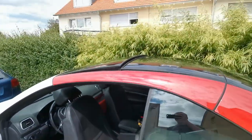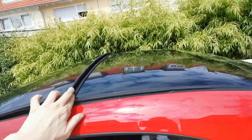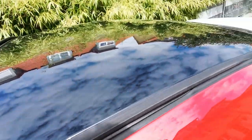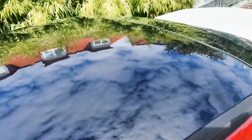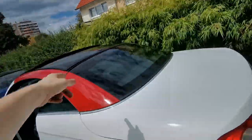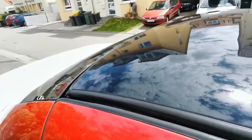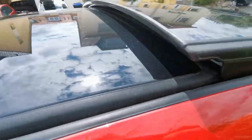We did pop the sunroof open before I disabled it because the panel is otherwise caught underneath. Look at all these dents. It's still caught under here, but the idea is to get it out from the front now or move it upwards and then back. I just did it — push up and forward to get it out from under the window frame in the rear. Same on this side — just push up and forward a little bit so it slides under the sunroof frame.